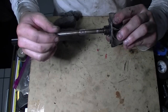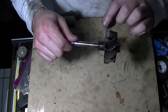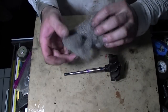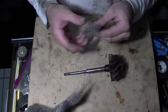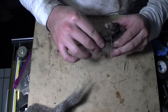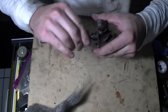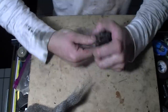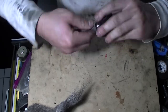I'm going to run it anyway. As long as it doesn't smoke and it spools without too much excess shaft play, I'm going to run it until it dies. First thing you want to do is get some steel wool — you can get it anywhere, like Walmart. You can even use a SOS pad. Just grab some steel wool and run it around where the journals are — get it real shiny if you can. Try to get it a little smoother. It's not going to take hardly any metal off, it's just going to polish it — pretty much the same thing they do when they polish your cranks.